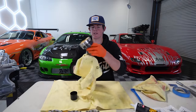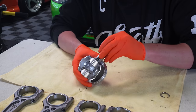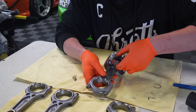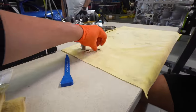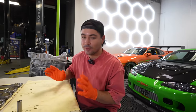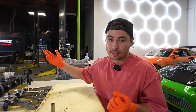That's one piston and rod done, and luckily the SR20 is a four-cylinder, so we only have three more to do. We've seen Nate, our social media manager, usually behind the camera — we're going to let him have a whack at putting a piston together. He was seeing me struggle with the circlips, because these suckers are tough. He's watched me do this on the RB, the 2J, and the 4G. The process is: circlip, wrist pin, connecting rod, and piston.